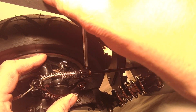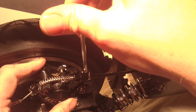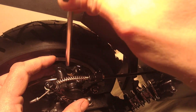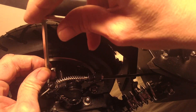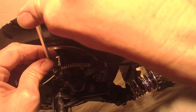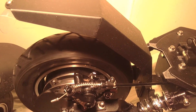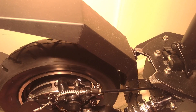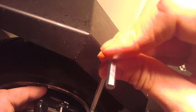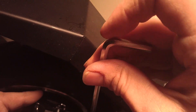The same principle applies equally to the front wheel. Just make sure you undo the bolts to free up the caliper, hold the brake cable or brake lever corresponding to that wheel, tighten up the rear allen bolt, then rotate the wheel backwards. Once you're happy, tighten the front bolt — but it is very important to hold the caliper exactly in that position as you tighten the front bolt, because you've just found a sweet spot that will do the trick.